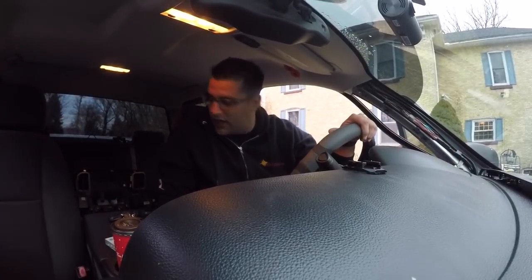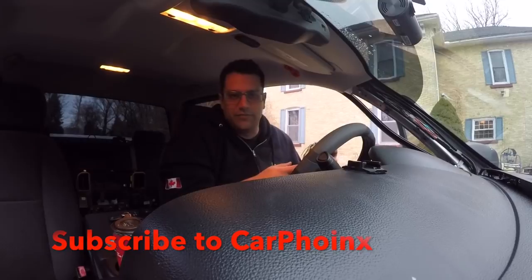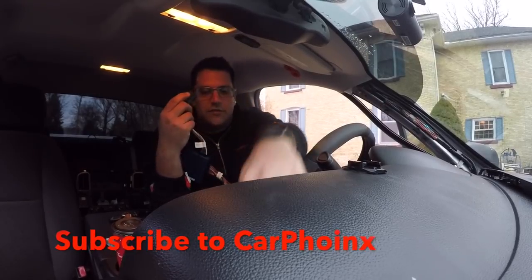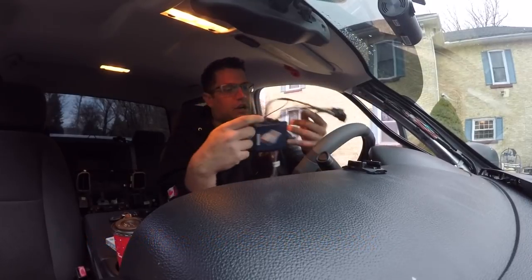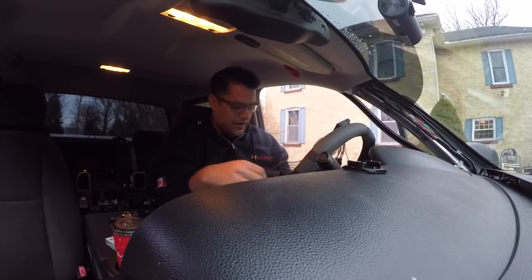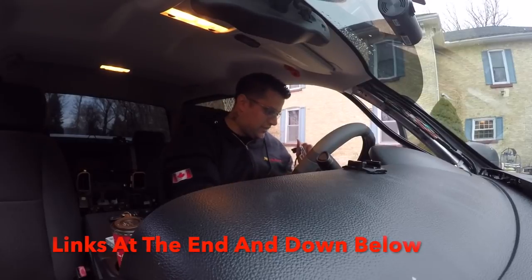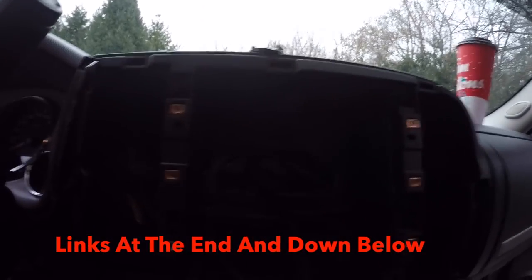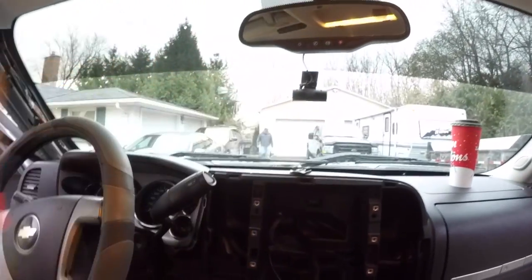I'll be back, boys. I'm going to go in and get a 10 mil and Gatlin's going to talk to you for a minute. We'll get this thing installed. We've got a pack harness here. So this module is an OS5, does a GM LAN 29. There are all sorts of different GM iterations for different models and makes, but this one's a GM LAN 29. I've got the factory plugs — these plugs will plug directly into our factory plugs right here. This will give us our door chimes and reverse trigger. He doesn't have factory satellite radio so he won't be using that harness. This one also retains steering wheel controls, but he doesn't have steering wheel controls — he has just a cruise, which is a separate identity. So once we get the dash cut out right there, we'll be able to get this module up underneath there nice and clean.